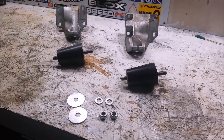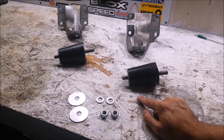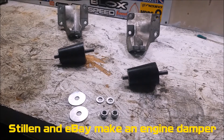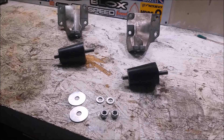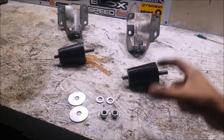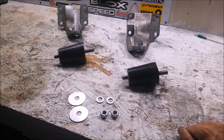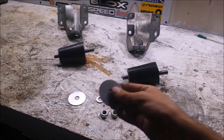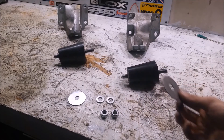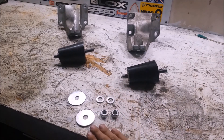One of the side benefits is these two engine mounts together weigh 2.5 pounds. The stock engine mounts plus the engine damper I had on the car weigh 10 pounds — I saved 7.5 pounds off the front of the car. I'm also going to have a much more stable engine, so really this is a huge benefit for only $50 and a couple of hours of time. If I was going to do this again, I'd use a true two-inch cylinder instead of the tapered cups, and I'd try to make the fender washers a permanent part of the piece by using them to seal the bottom of the container.